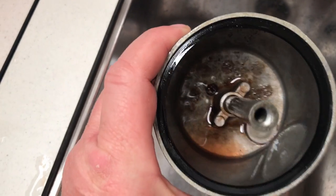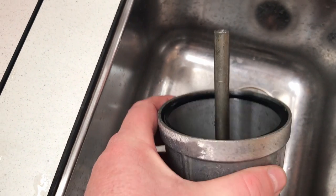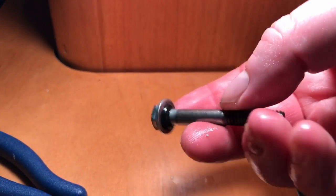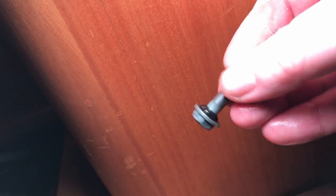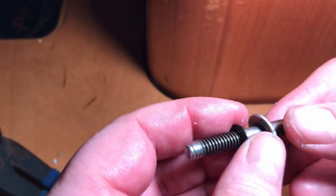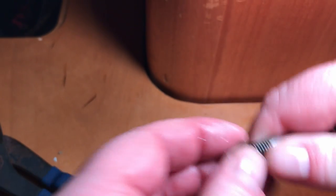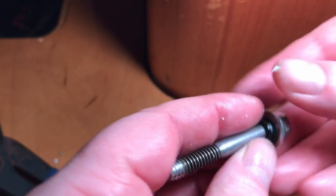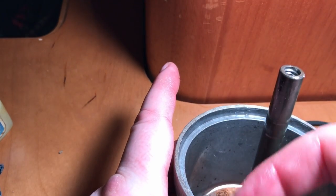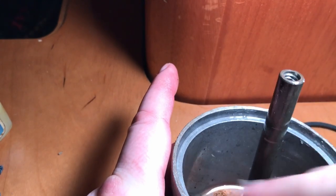The pre-filter includes a water separator bowl, and I'm pleased to see no evidence of sludge or water in the bottom half. With this filter there are some O-rings to replace — one of them is there, and it's quite easy to do: you just switch the washer down and then pull it off. We put the new one on, nice and neat, and we'll wipe around a little Vaseline again.